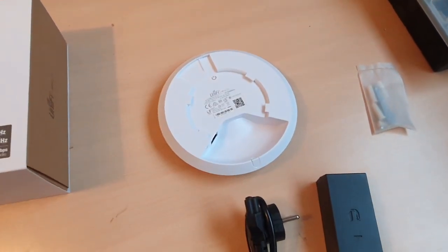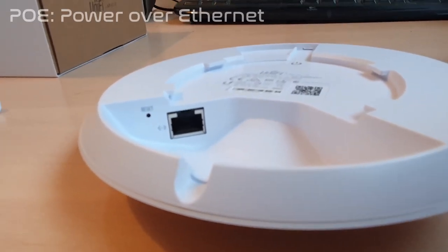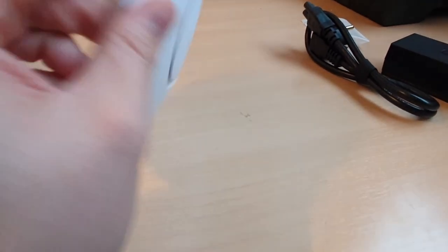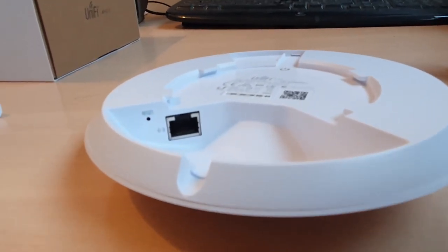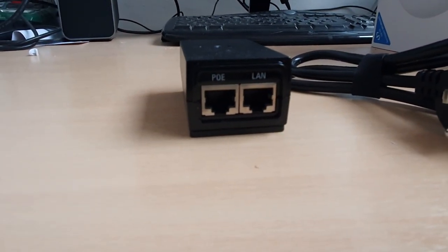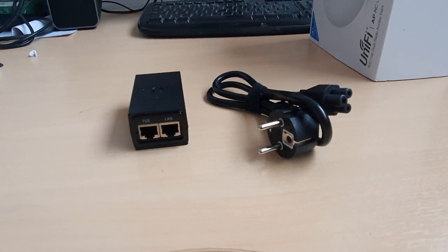When we open up the plastic backplate, we can see the inside of the access point. There is a reset button and a port to plug in a UTP cable. There is no input for power because the access point uses PoE, or power over ethernet technology. Like an old-fashioned phone, it draws its power from the ethernet cable. Normally ethernet does not provide enough current to power a device, but PoE gear can send more power over the ethernet cable. UniFi provides a PoE adapter with its access points. On one side you plug in a power cable to a wall outlet, and on the other side there are two ethernet connections — one labeled LAN goes to your switch or router, and one labeled PoE goes to your access point. Easy as that!